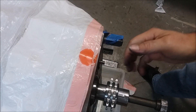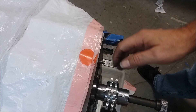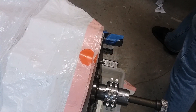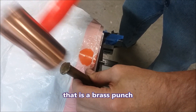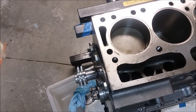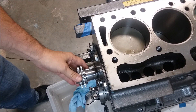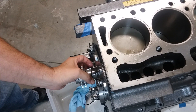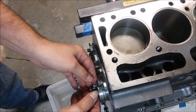Now the goal is to see whether this will align so I can pull this on and off, and once I get everything lined up, I can get the crank gear and the cam gear lined up by adding different shims. I had a couple of motivations for wanting this crank gear to come off easily. The first was I thought maybe I might have to change this shim, which sets the alignment of the gear with the cam gear. I've now got the cam installed.